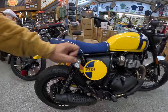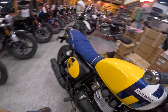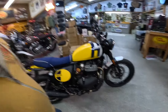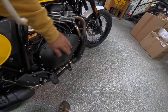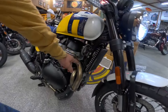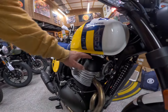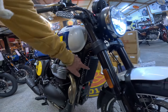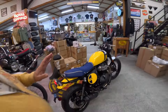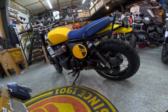Here's the pipe — it's a two-into-one pipe now. Heat shield up front, heat shield back here. The rumble is awesome; very good sounding bike. They moved the foot pegs forward and down a little bit and there's a neat little guard here — this is cast metal. These are the same foot pegs that are on the brand new Himalayan; you can remove the rubbers if you want. Same brake lever and shift lever as the new Himalayan. One of the reasons they moved the pegs forward and down is because the bike is made to be stood up on — it's a scrambler. Ground clearance has increased to 7.6 inches, about 187 millimeters. Wheelbase was increased about two and a half inches — I think it's 57 and a half inches, about 1460 millimeters. The rear tire is now a 17 instead of an 18, with spokes and aluminum rims — whole new rear end. It jacks up like this, with a metal grab bar on the back end.